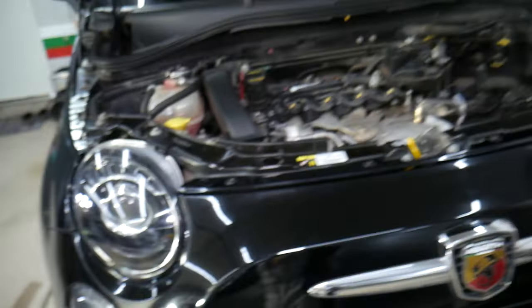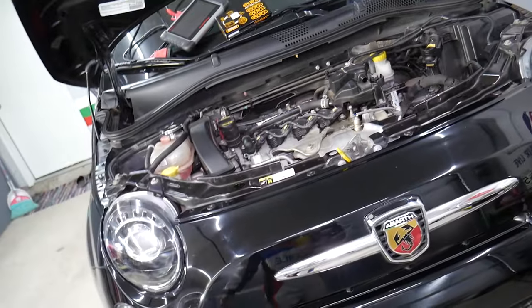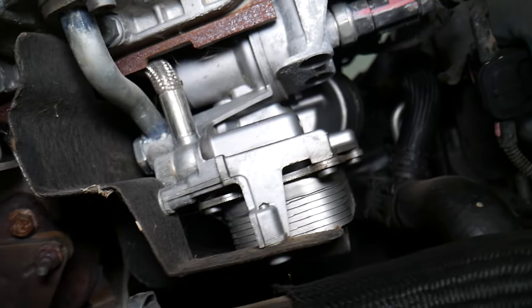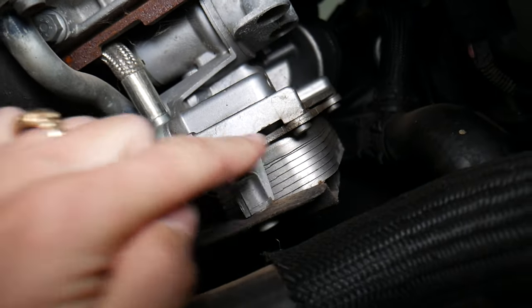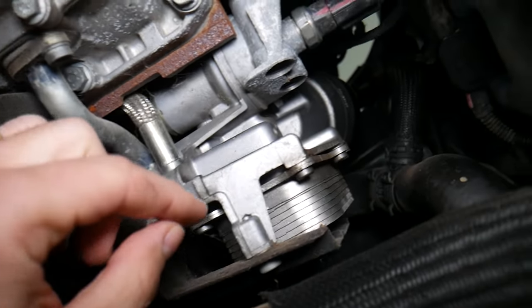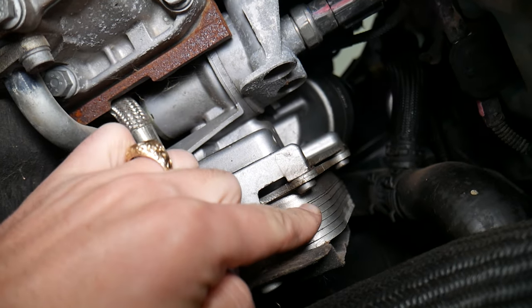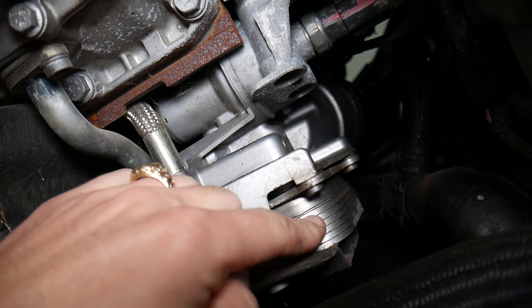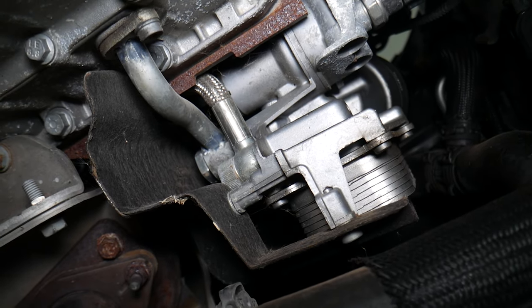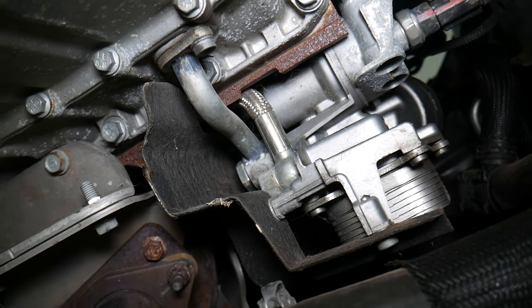Most of the time, we have one special device that is known as the oil cooler. On these modern cars, you have an oil cooler — and depending on the engine it may be in a different position, but ours is on the front side, right here. In that cooler, you will have coolant and engine oil going through it. The engine oil goes through it and the coolant runs through the channels next to it, keeping the engine oil at a certain temperature — practically cooling it.